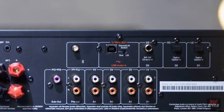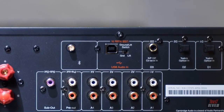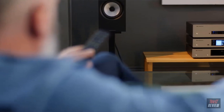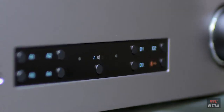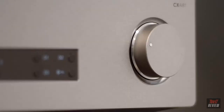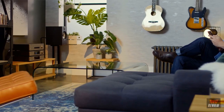It's not all about the DACs though. The CXA61 now has a Class 2 USB input, just like the CXA81, so both amplifiers are capable of supporting 32-bit 384kHz PCM files and DSD256 from a Mac or a PC. Built-in Bluetooth reception is another important digital upgrade. Thanks to aptX HD support for high-res 24-bit 48kHz, CXA owners can say goodbye to optional Bluetooth dongles and hello to a fast, convenient and high-performance connection.